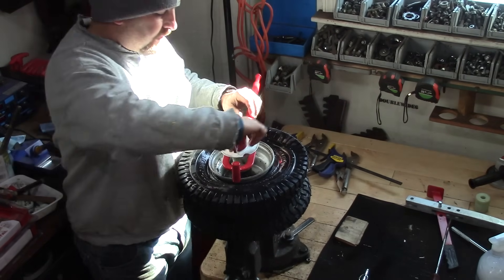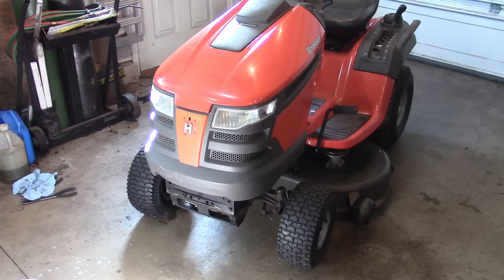It does take a little muscle, but that's basically how you do it. Got everything on there and it's looking pretty good, I'm happy with the results. One thing you want to watch for - if your tires are directional, make sure you have the valves out on the right side. I have these two matching up nice, so just pay attention when you're doing it. I'll put links in the description to how to actually seat a tire on the bead - I didn't show it in this video but I have done it in other videos - and also links to the tools I used. Thanks for watching guys, if you like this please give it a thumbs up and think about subscribing. Take care.